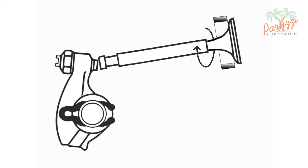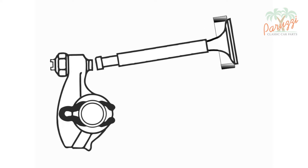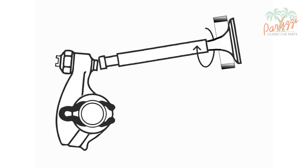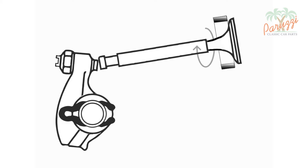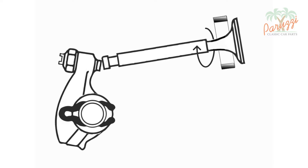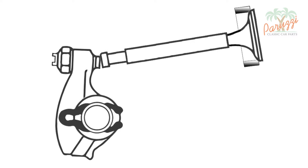This animation shows how the rocker arm with its adjustment screw pushes away the valve stem in order to open the valve. Due to the rounded shape of the adjustment screw, the valve stem and thus the valve will rotate. When closing, the valve will hit the valve seat with a big force, but because the valve is rotating, the force will be distributed over the surface of the valve seat. This avoids the valve slamming into its valve seat.